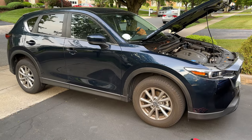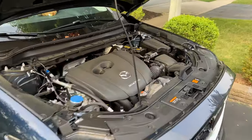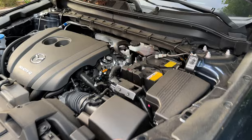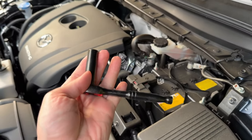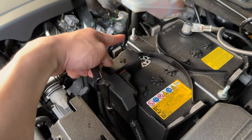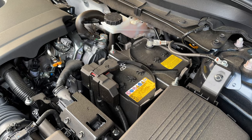What's going on guys? Here I have this Mazda CX-5 and today I'm going to show you how to replace the battery. It's a really easy process. Basically we just pop the hood here and the battery is located right here. Grab a 10 millimeter wrench, basically undo the positive and negative leads and then these two bolts to take out the mount. So let me go ahead and show you how that's done.